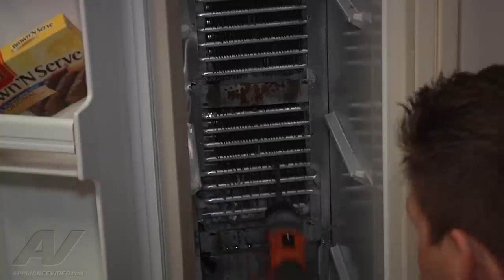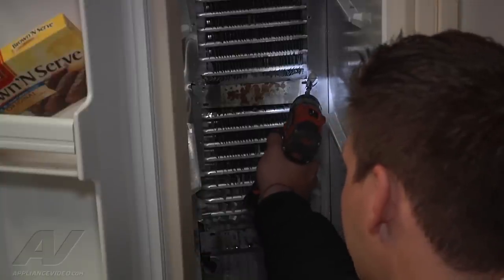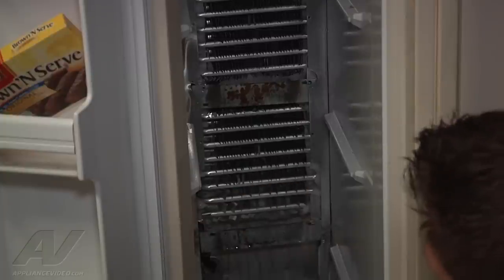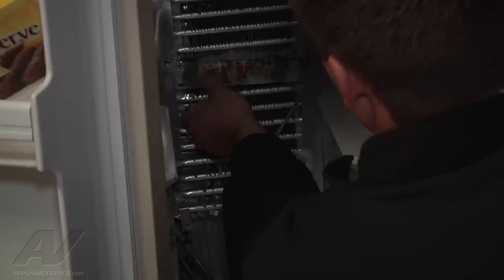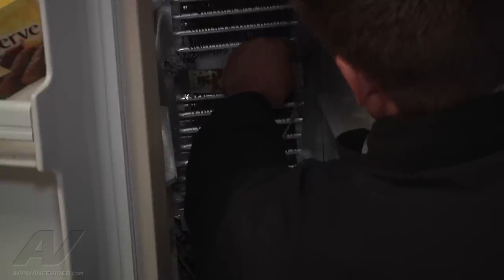The wires go up to the upper heater. We got those screws out of the way. Now I'm going up to the terminal block to disconnect the two heater wires, and then I can start to remove the heaters. I'll remove my two wires — the bottom one is simple to remove, there's a lot of extra room. The upper one we have to bend the frame a little bit to get some extra space. Getting it out is no problem because we're putting in the new one, but getting the new one in can be a little more difficult.